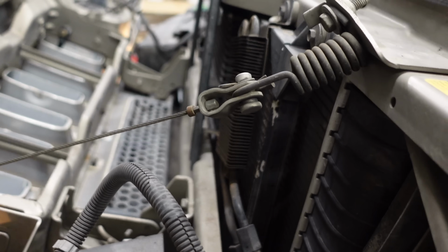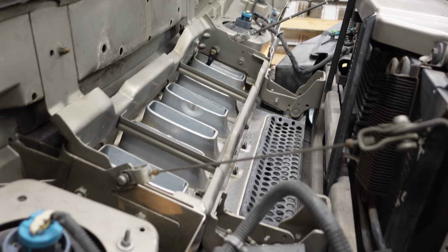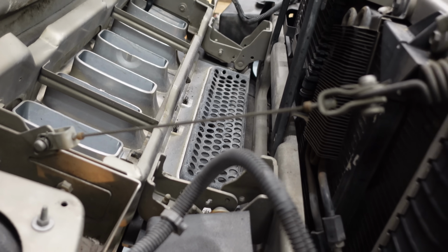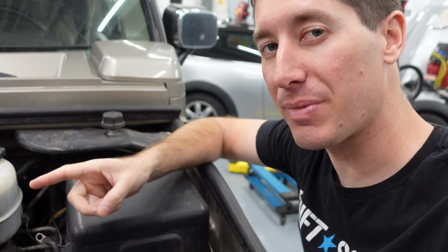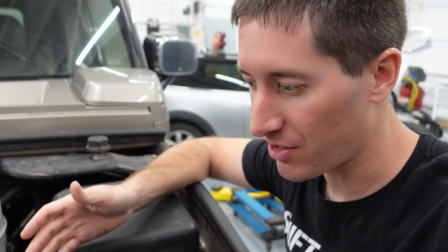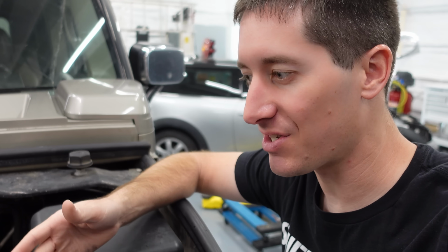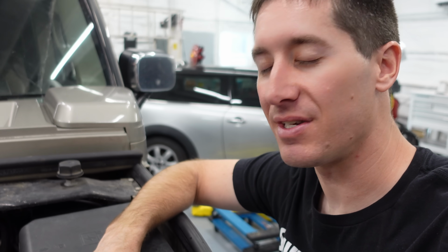There's those springs I was talking about. Even if you fling this hood open, it'll probably be okay. I wouldn't bet money on it, but it would probably be okay. While I was in here swapping out that other belt tensioner over on the passenger side, I spun the alternator and I spun the power steering pump. I didn't feel any bad bearings. I didn't hear any squeaking noise. So I'm really thinking that it's the tensioner on the AC compressor.